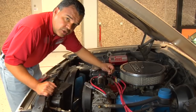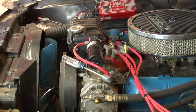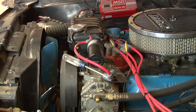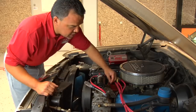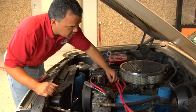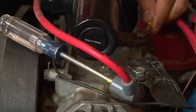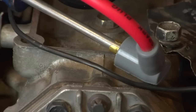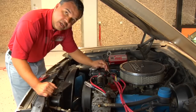For this application, we're testing a point-style distributor. The MSD box is being triggered via the white wire. So once you set your screwdriver close to ground, you're going to actually see the spark occurring at this point. As I tap it and release from ground, a spark should occur. This test concludes that the MSD box and the coil are working properly.